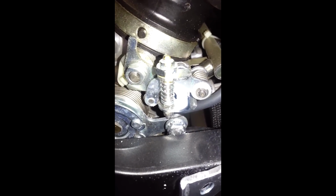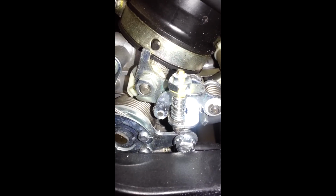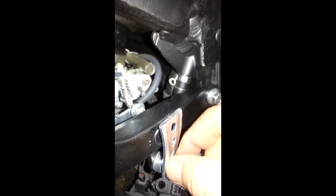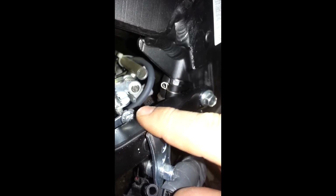This is an extremely important part of installing this cruise control, and I'll tell you what, it can be deadly too if you don't do it right. So this is where you need to take your time. What I did is pretty simple. I just furred this little piece out with washers right here, put this in, got it up here, and then I cut it off with my Sawzall, and then just filed that down.